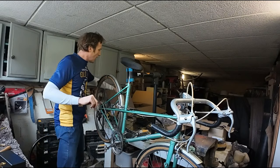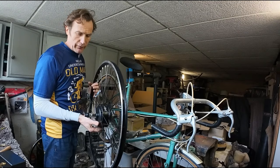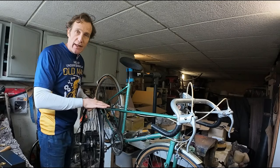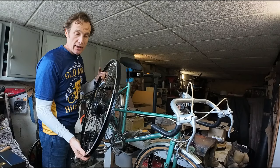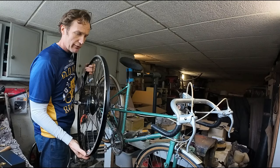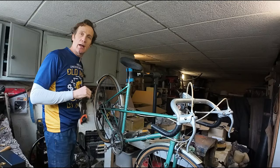The hub motor I went with is this one here — a regular kit available on eBay, 250 watt rear hub motor. One thing you do need to check is your spacing on the rear dropouts, because a lot of these motors are set up for much more modern bikes which have a much wider rear dropout spacing. This one should match. It is black at the moment — I could not get silver — so I'm going to have to spray it silver because I can't handle black on an old bike like this. We're going to spray it silver and stick with that theme. In the meantime, I'm going to pull this apart, clean it all up, see how I can tidy up the paint, and then get going on the conversion.